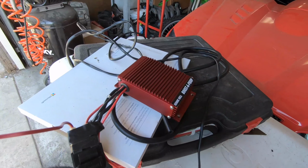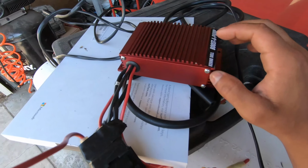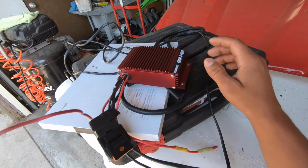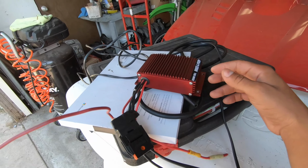First off, I'm going to be installing this with a Hobbs switch that I did get from NAPA, which is set to open up at 4 pounds of boost. Now, for those who are asking, what the heck is a Hobbs switch? Most people tend to run these at 100% all the time, meaning you are getting a lot more fuel pressure, which also means you're going to be burning a little bit more gas. So, of course, I don't want that. The purpose of a Hobbs switch is you can set it at a designated PSI, and once you hit that PSI, it turns on and activates the booster pump. So I'm going to be activating this at 4 pounds of boost, meaning when I'm cruising, this booster pump will not be activated. So I'll be chilling. The moment I start getting on it, the Hobbs switch will kick in once I pass 4 pounds, activating this.